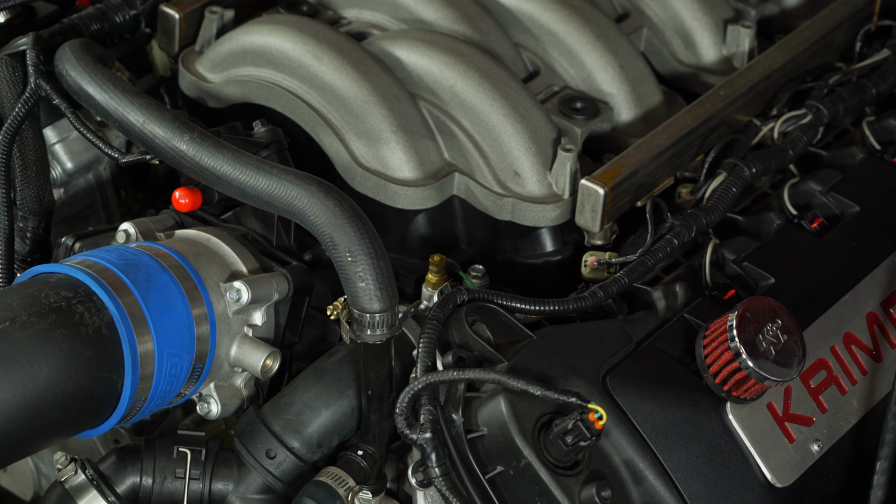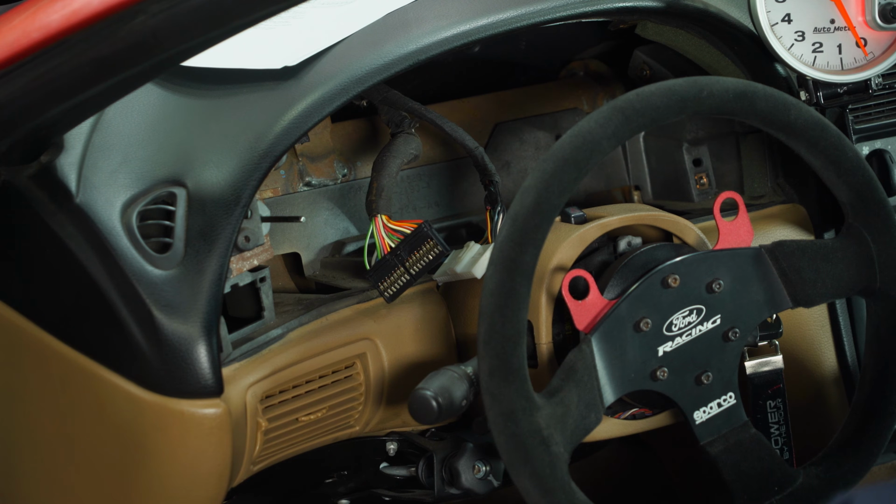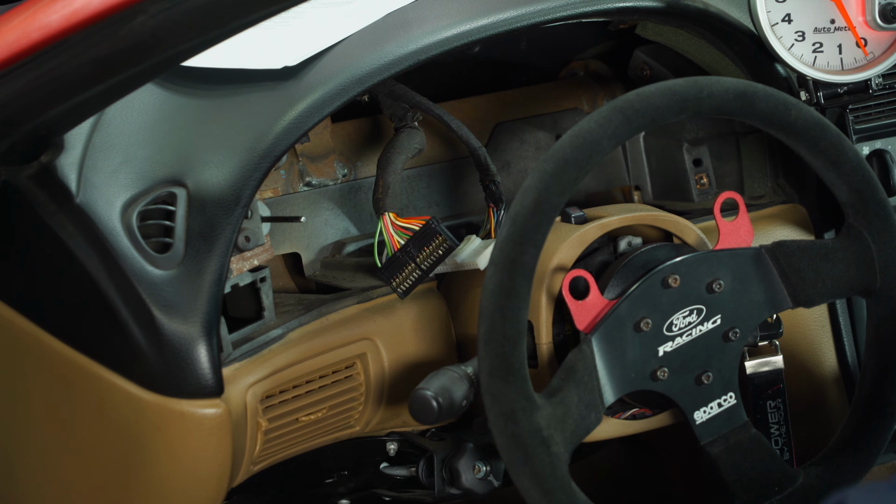We just want to make sure we get the best thing we can for the higher quality gauges. All right, so there's 7 connections we can make right here at the 2 factory plugs. We're going to be able to plug in our ground wire, our gauge lights wire, our 12-volt ignition wire, fuel gauge wire, left turn signal, right turn signal, and then our high beam.